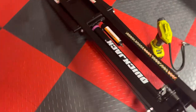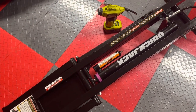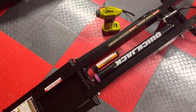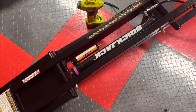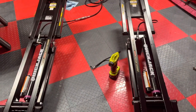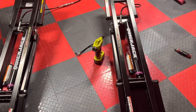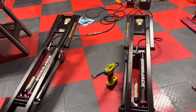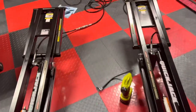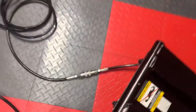All right, just a real quick note. This air cylinder had lost about 37 PSI. It was down to about 8. That one was fine. So I tightened up the Schrader valve a little bit, even though I tightened them a few days ago. It did turn a little, so hopefully that'll do it. Yeah, the air's got a bad valve and I'll have to switch it out. But I can confirm there are no leaks anywhere. That little bit on the napkin was it. Must have been a little bit of the thread sealer.